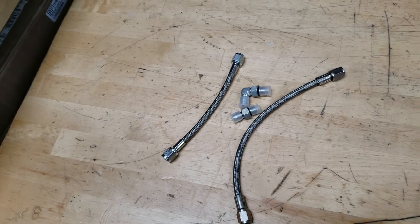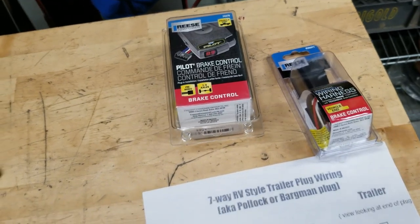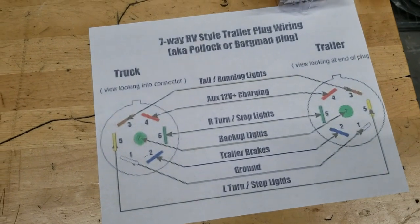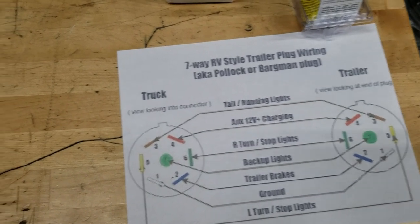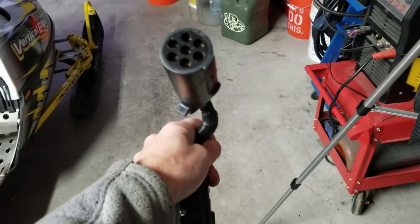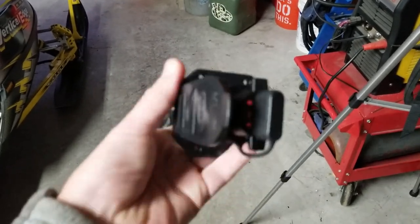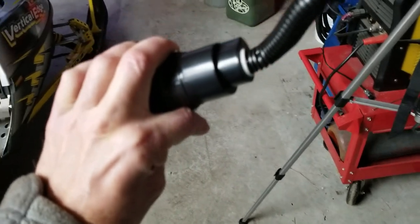And then, time-dependent, I want to try to wire in an electronic trailer brake controller. I've got a pin out here. I'm going to do some investigating and see if our military 12-volt plug is wired, basically, if there's a wire going to the correct pin on there to convert it over, because this is a 12-pin to 7-blade connector. I've just got an adapter stuck in here for right now, but I'm going to try and decipher this whole shenanigans and see what comes of it.